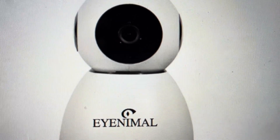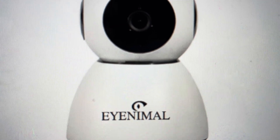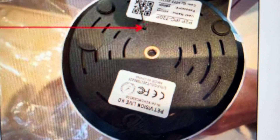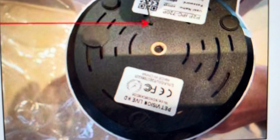Just keep in mind you will have to re-pair it to the app and everything after we do this. But if you'd like to do it, it's real simple. All you need to do is come up underneath it and you're going to need a paper clip or a pin or something like that, and you're going to find this little reset hole down in the bottom. Press and hold it for about 10 seconds until the Pet Vision makes an audible beep, at which point you can let go and your Pet Vision is reset.